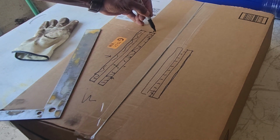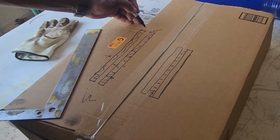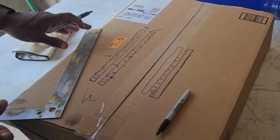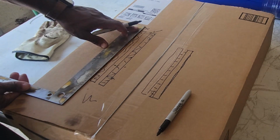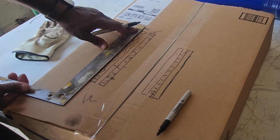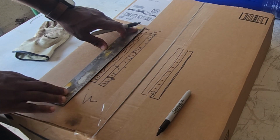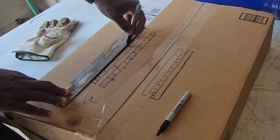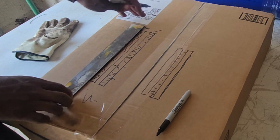So this is a good rotor. It's perfectly straight. This is a bad rotor. It's wavy. So when they put a lathe on it and cut out all of the high spots, all you end up with is the low spots, but you end up with low spots that are evenly spaced like that.